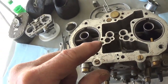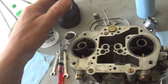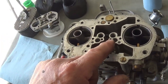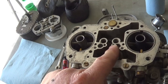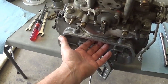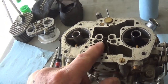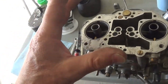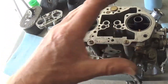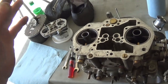Now, sometimes these things are self-cleaning. You have the top that goes in here and all this stuff, and when it backfires and snorts, that's a backfire from clear into the intake manifold. And sometimes if the throttle is partly open, you'll get back pressure. That's why on some cars that are badly out of tune, you'll have carbon and stuff higher up into the carburetor area. And it's like, why is this all black? Where does this junk come from, you know?